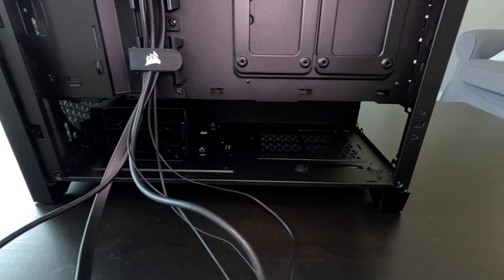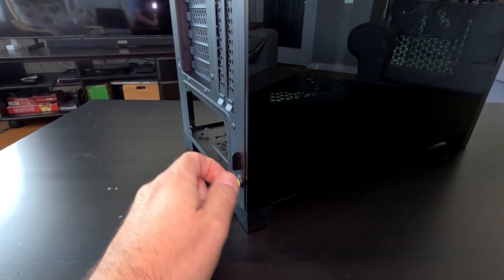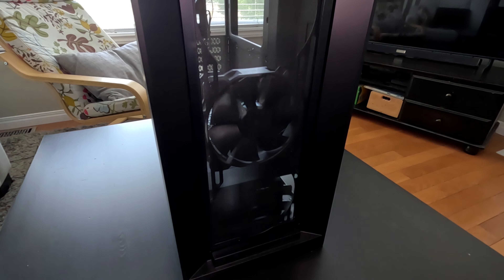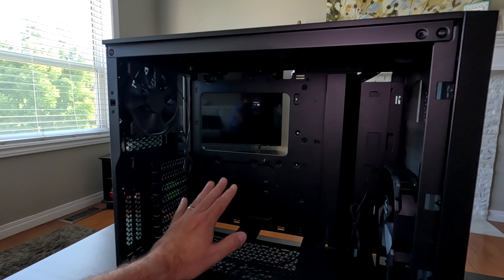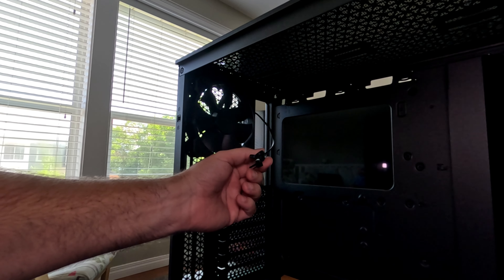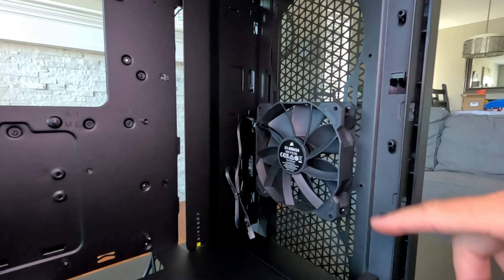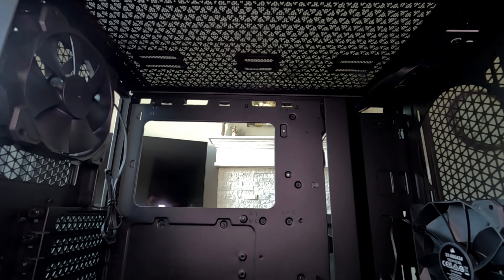You can remove that bay and have a lot more space for all your cables underneath there. So let's go ahead and remove the tempered glass panel — again two thumb screws that you remove. Really nice tempered panel here, you need to pop it out at the back and then remove it like that. I did want to show you that this front cover is fully removable as well, and you can see there's a dust screen in there that you can easily clean out. So inside the case here you can see where your motherboard goes — standoffs are here — and this is compatible with extended ATX, ATX, micro ATX, and mini ATX. It does come with two fans: a 120 millimeter fan on the back with a three-pin connector, and on the front another 120 millimeter fan with a three-pin connector as well. It does say that this fits a 360 millimeter radiator on the front, and up on the top it says 280 millimeters on the roof depending on the RAM height, so keep that in mind if you're buying a radiator.